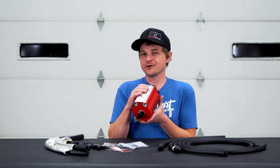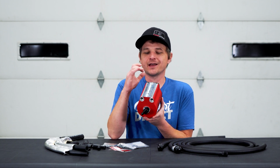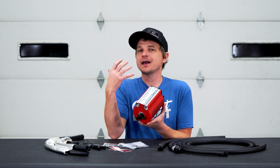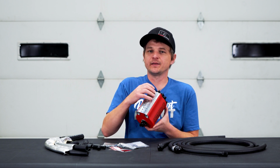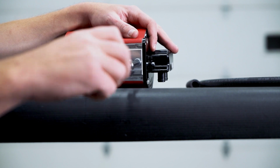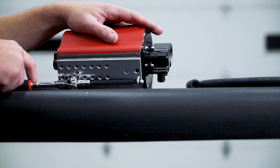And then another thing here on the mounting plate, that little guy right there, that's actually a coolant bleeder valve, which is awesome. I hate the Subaru cooling system, how difficult it can be to bleed. So to have something sitting way up high in the system, allowing the air to escape, you crack that open, wait for it to bleed through a little bit of coolant, close it back up, and your system should be completely bled of any air. Very, very smart. So now let's talk about what's the same.